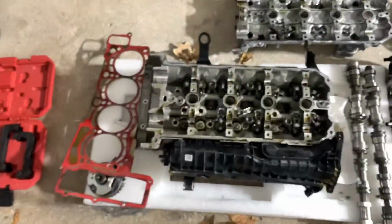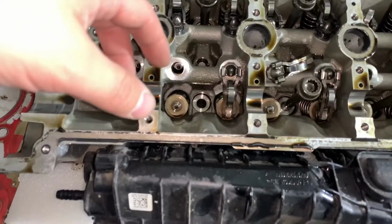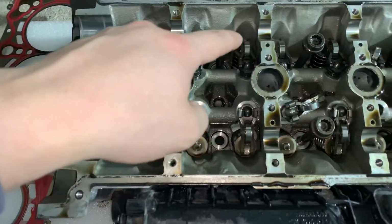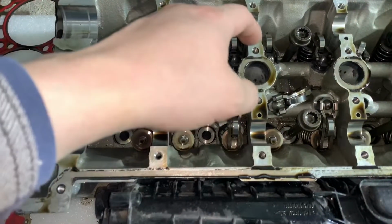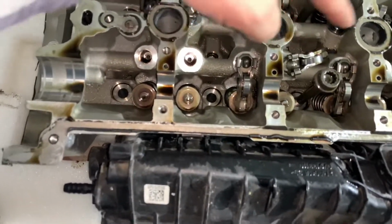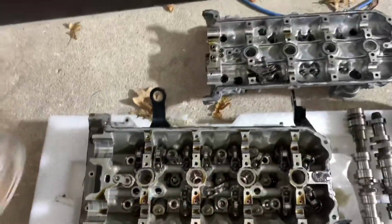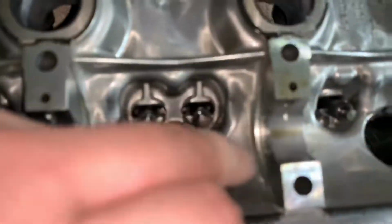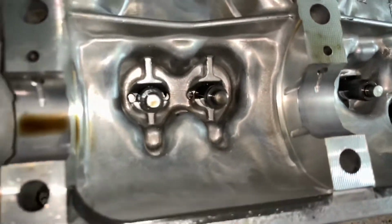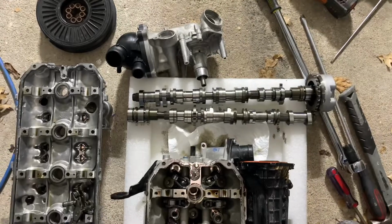Okay, here are the heads. About the heads, it's pretty much the same design as the V6 and regular V8, right? The way they supply the oil in here, I think this is the main issue with these Audis. They should add oil supply in the bottom over here too. Or like the V6, the last generation supercharged, they add another line of oil feed. So it's pretty much just spraying on the camshaft itself, which helps a lot to cool off and reduce friction. They all got a bit of marks. This one doesn't look too bad, but the other one got a little bit more damage.